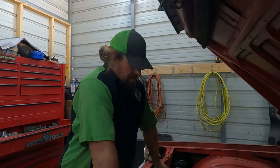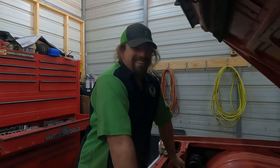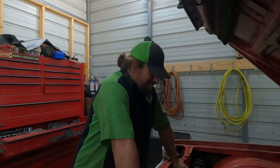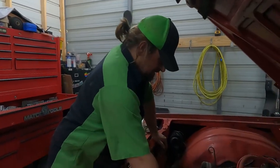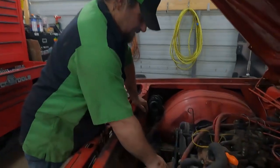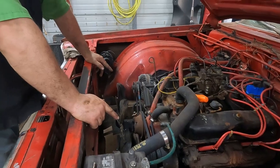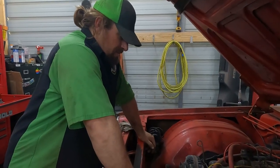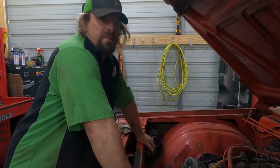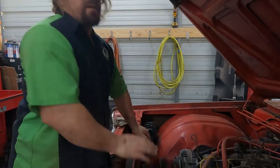We're gonna have a problem with the power steering. Challenge. No, it's gonna be a problem. The bracket is obviously off of the poly because it has an extra bolt over here, and our new water pump's not gonna have that bolt. I have a box of stuff over there, but I don't think I have any small block power steering brackets in there. I have a brand new rebuilt power steering pump, but it's in Colorado. Anyway, we'll figure that out when we get there.